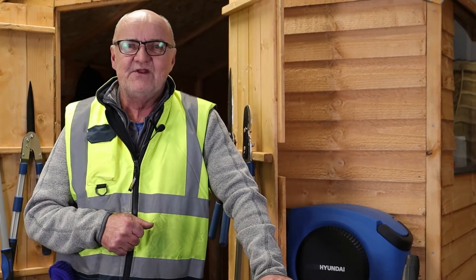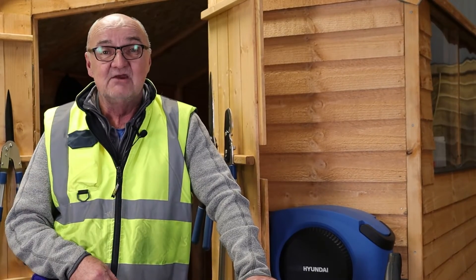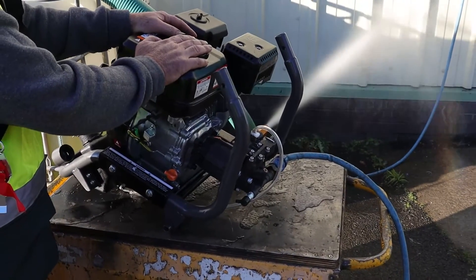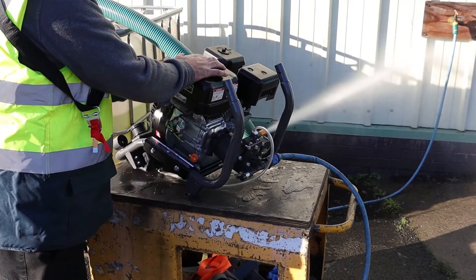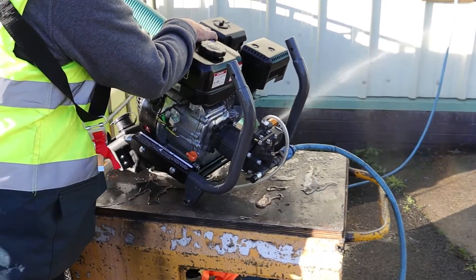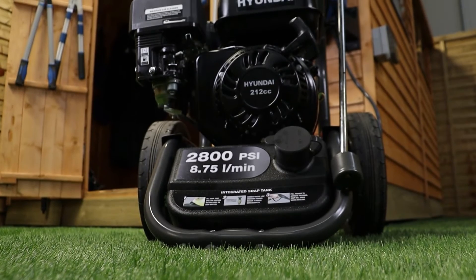It's difficult to describe what hunting means — it's a variation in the RPM of the engine. I've got a video clip here of a pressure washer that was actually doing this hunting, so I'll insert this here and you can see exactly what I'm talking about. I hope that explained what the hunting is: that variation in the RPM of the engine.